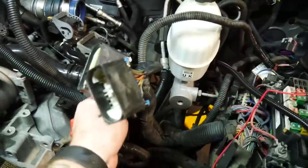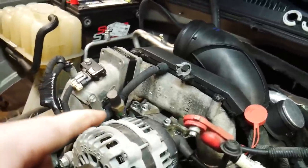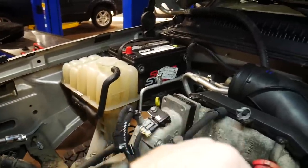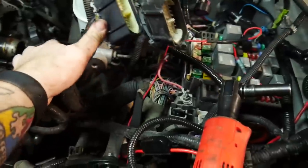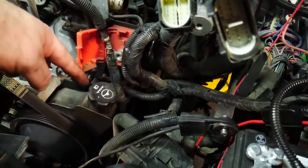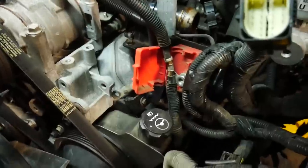So this was the harness that went across the whole front side of the motor. The harness went all the way across there and went over to the alternator, to a couple of our sensors down in there. And it actually wrapped up around, went to the AC ports over there and the low coolant level sensor on the bottle also. So that whole harness got brought over and folded over — that will stay up with the body. And then there is one little ground cable going down to the lower part of the block. You're going to have to get that one off to bring up the rest of that cable.